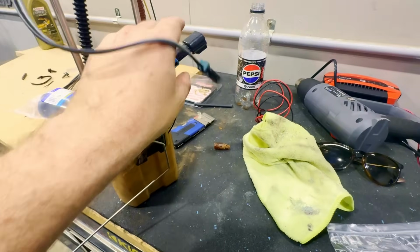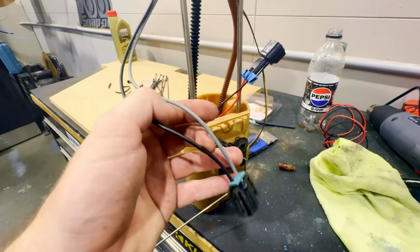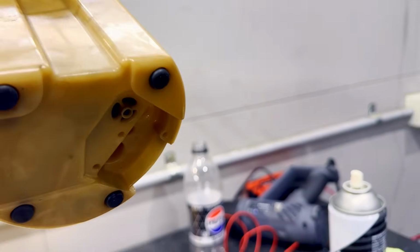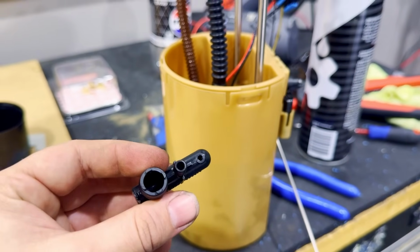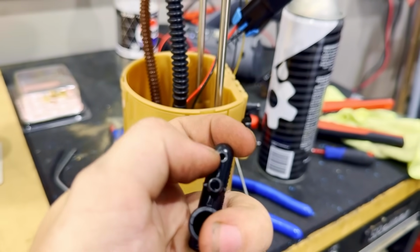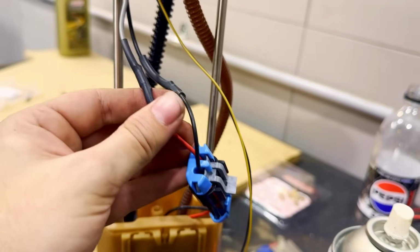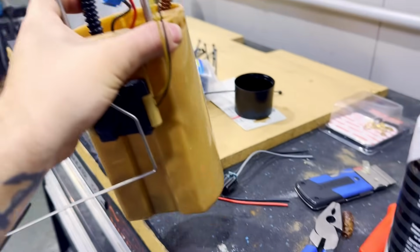So now the next thing I need to do is go from this plug here to this plug here. Oh God, different coloring. Love that for me. Let's figure out exactly what this is. The other thing you'll also want to do is, at the very bottom of these, there is a restrictor or return little pipe thing. Weirdest thing, it returns back into the surge. This little tiny thing at the very end you need to drill out. Gene's been my savior. Then we can reinstall that one back into the bottom of this. Also with the wiring, I found out that the gray is the positive there, and the black is your ground, of course. After that, this will be ready to just drop straight back in the tank.